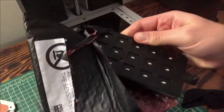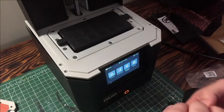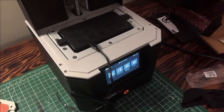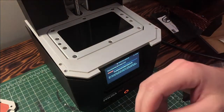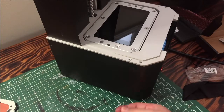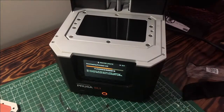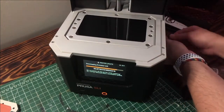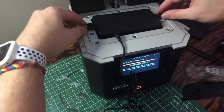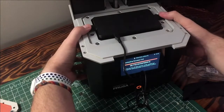Regarding this calibrator thing, I really don't understand what its purpose is. I guess all those little recessed things are sensors, and I guess they're measuring the UV output — maybe just making sure there's no dead pixels. But I was under the impression that the need for this calibrator was more of a software thing. Basically, the information on the screen doesn't match what was in the printer when it was first made in the factory, so it kind of rejects it — like rejecting a new organ. Somehow this calibrator overwrites that in the firmware and also calibrates the screen. With the Prusa system, you cannot buy a new screen without getting the calibrator, and later you have to contact them if you need new screens, saying that you already have a calibrator.